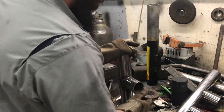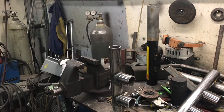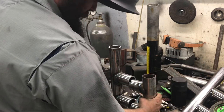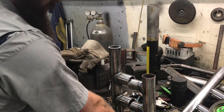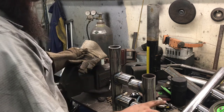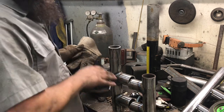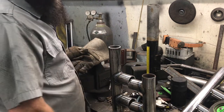I am working on the front post here. Here is the rear post — we got a two-inch section here. Notice it'll line up. I did that for a reason. This is a two-inch space here, a two-and-a-half here. So across the entire rail on the side of the truck, I will have a half-inch of fall, encouraging any liquid that gets condensed out to get to the back of the truck and into the rear condensate tank.